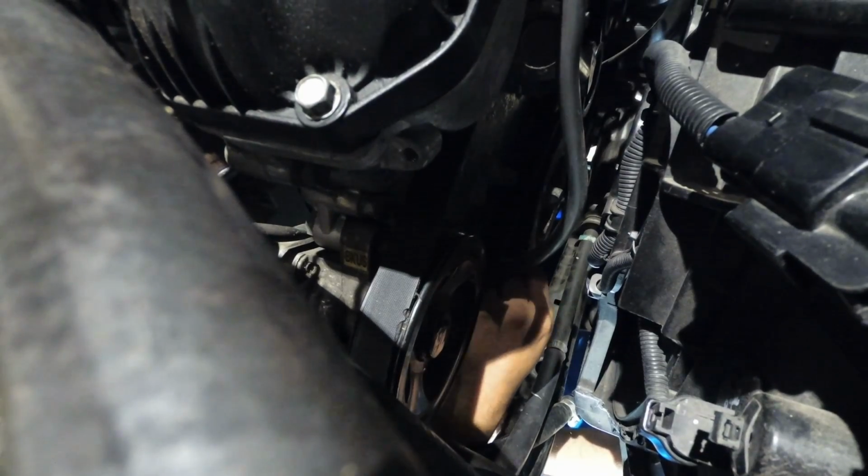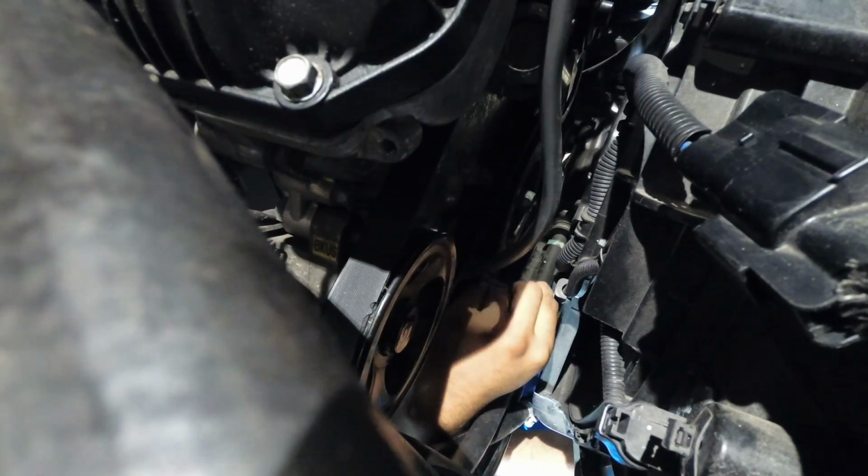The thing you need to know is when you're tightening this on, you are not going to tighten it on with a lot of force. You can strip the threads inside the head or the block itself, or you can snap the bolts inside. The bolts that we'll be providing you are very strong bolts. So the aluminum in the block will strip before the bolt breaks. So be very careful when you're tightening these to only put them in snug and then give it another tug.